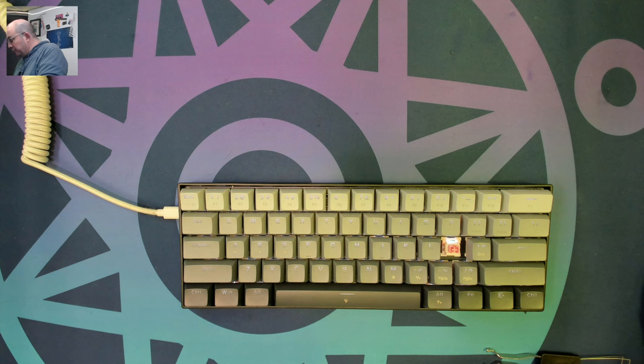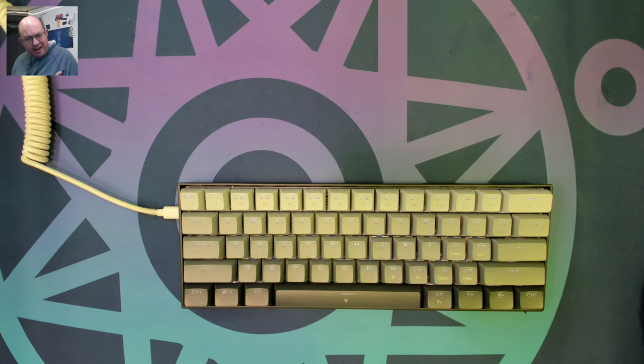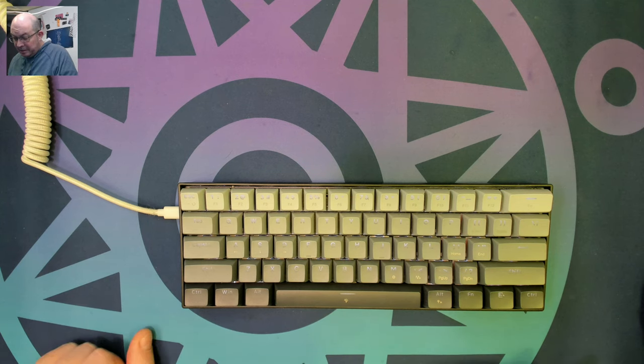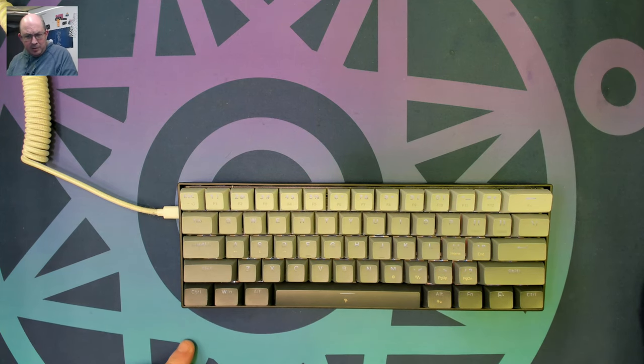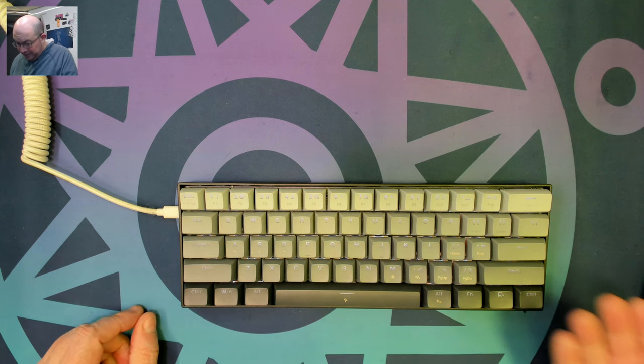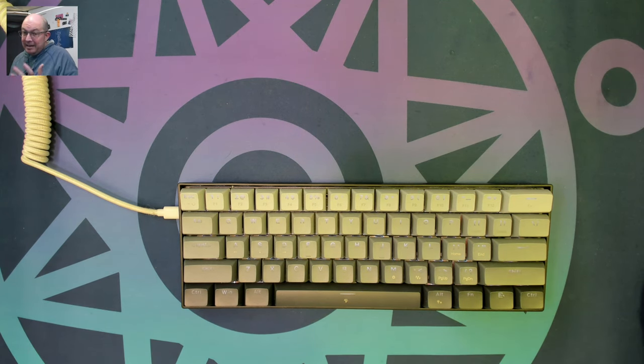Now, I do know that magnetic keyboards started to appear, I want to say, a year and a half ago or so, and they were pricier, but the prices have gone down significantly. I don't know the exact prices of the individual components, but from the number of keyboards that I've seen, I do believe this was the least pricey one. That being said, I still would have appreciated some dampening between the plate and the PCB, a different plate, aluminum, PC, anything other than steel.